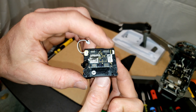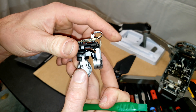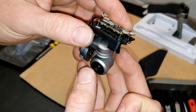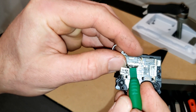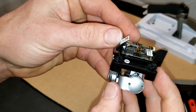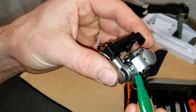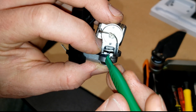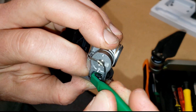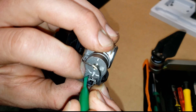Before taking the part, let's take a quick 360 view of what it looks like. Very delicate looking. You can start by popping the top ribbon cable off right there. And then it looks like we have to get this cover — so it's three Phillips screws on this cover. And under that, this connector has some silicone on it, so let's see if we can cut that silicone and pry it up.